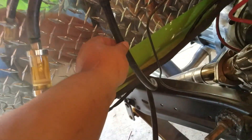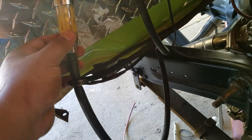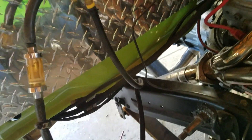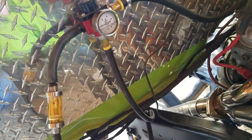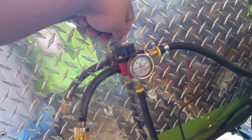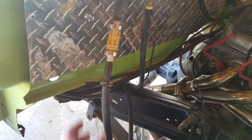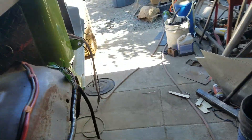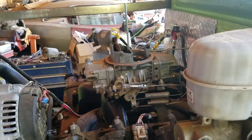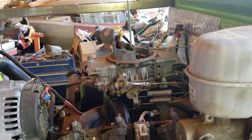This is what the fuel pump looks like after it's running. I've got a feed line and a return line — I put a little filter on the return just so I can monitor the fuel condition and make sure fuel is going back with no problems. The feed line goes to the carburetor and as you can see it's reading 3 psi — that's what I have it set at. I actually have the pressure controlled not by the regulator but by this hose clamp — you block off the return just enough to build pressure. If you block too much, you'll dead-head the pump and go to max pressure and have a lot of problems.